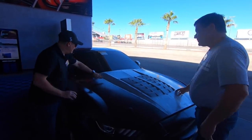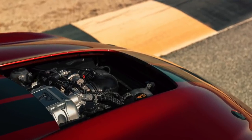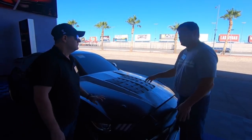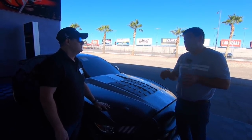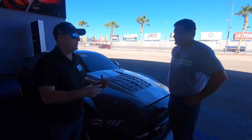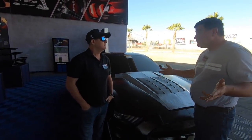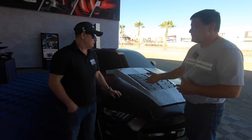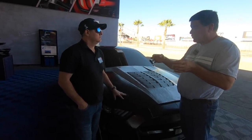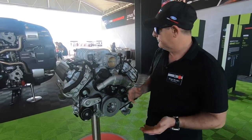The buck simulates the contours of the hood and its openings. They changed out different components and ended up with over a six-square-foot opening. There's a rain tray that you remove when going to the track. Being able to iterate so much faster in development allowed them to increase performance within the same timeframe and budget. Engineering time and wind tunnel time adds up — swapping parts in a shorter period means greater performance gains.